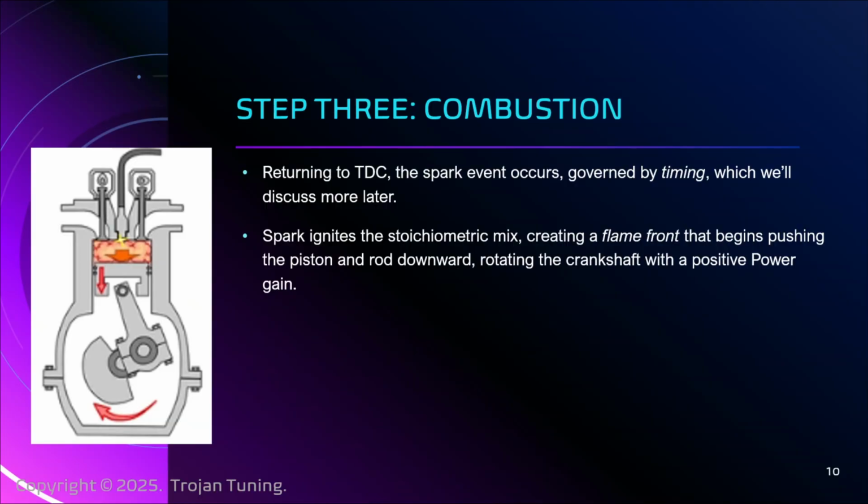Now, what does that mean? If you haven't heard of stoichiometry before, the idea here is that the amount of air molecules compared to the fuel molecules is at a golden ratio where all of the oxygen is consumed and all of the fuel is consumed. I don't have anything left over. With gasoline that has no ethanol added, it takes 14.7 molecules of oxygen to match 1 molecule of gasoline. You put the two together, you put the conditions together properly for the pressure and all that, and you ignite it, and they will both burn off clean, essentially leaving no residues behind, right? It's not quite true, but we'll say that for now.